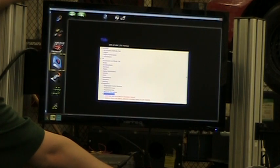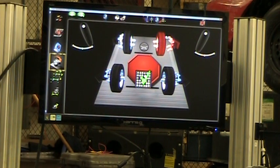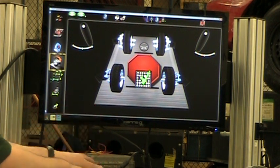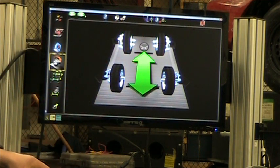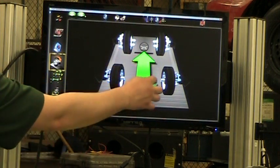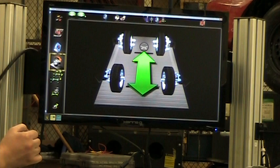We're going to hit the green next button. I can see the wheels are red on screen — when they're red, the camera has not connected with the wheel sensor. Once they turn black, the camera sees them and we can keep going. If you see a green arrow show up, we're going to roll the car backwards to do the rollout.